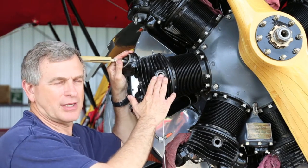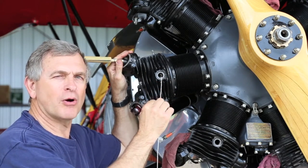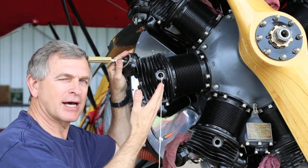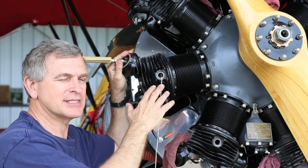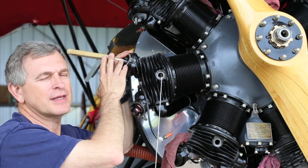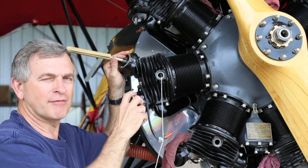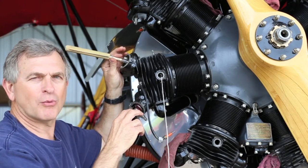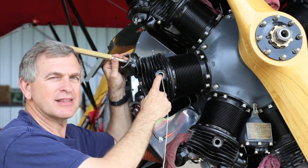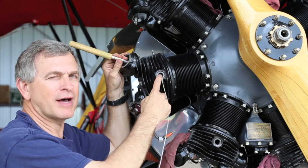We have all of the rope now in the cylinder — about 30 feet of quarter inch nylon rope. A nice thin rope will give us good packing in there. I then raise the piston, pull it around with the prop, and pack that rope up tight against the valve to keep it tight against the seat. Then I went ahead and took the rocker arm off, of course, and the valve springs, and put on our nifty little valve grinding tool that we made. It's safety-wired so it can't come off the end of the valve — we certainly don't want that to happen. Now I have a little room to work with. If we look inside the spark plug hole, you can actually see the valve all the way around — it's a beautiful shot in there. And that's where we're going to put our valve grinding compound on the valve.